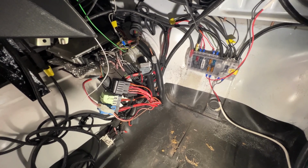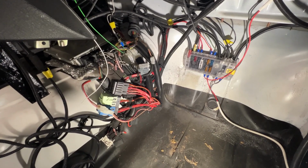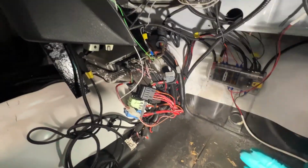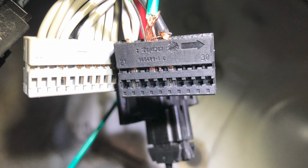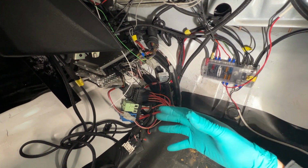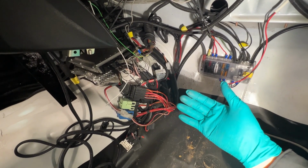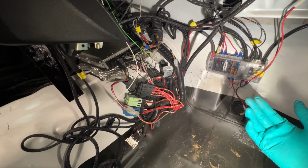This is it. I figured out the issue with the throttle. If you take a look at some of my previous videos, I had an issue with the throttle. I pressed the throttle and it was not working, and I didn't know why. And now I know why. The issue is pin drag. Inside one of these connectors from the eBay harness that I bought, the female socket was too large for the pin. So the pin would be loose inside the socket, not giving the ECU a proper reading. It would go into a limp mode, per se, and give that poor throttle response. So I redid a lot of female pins that went into the ECU and it fixed the issue. 100% throttle, super responsive, no issues.